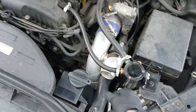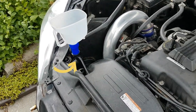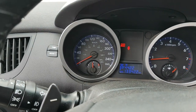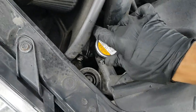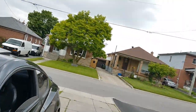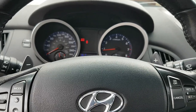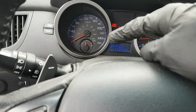The temperature is about 84 degrees. When I squeeze this, look what happens — you can see water popping out. That means this radiator is without any air. I'm going to turn off my car now and the gauge is looking good. Now I'm going to turn on the car, put the heat on max, and let the car idle for 10 minutes. I'm going to keep close attention to my coolant gauge. If this starts spiking up, that means there's air in the system.